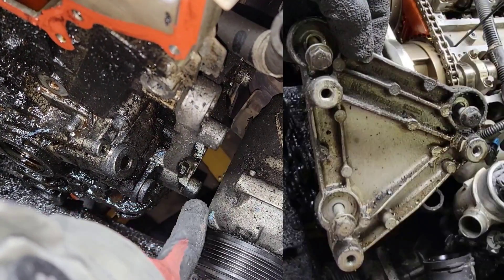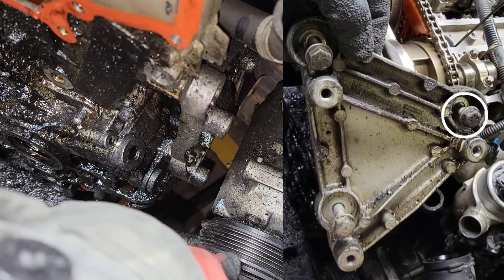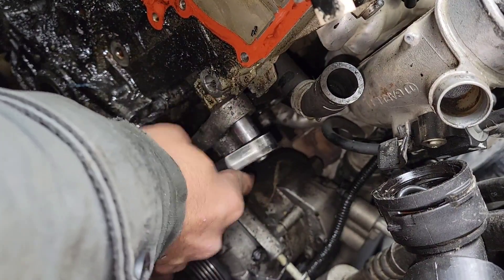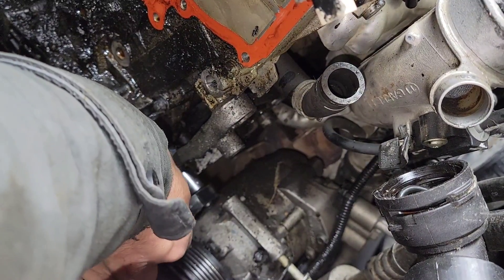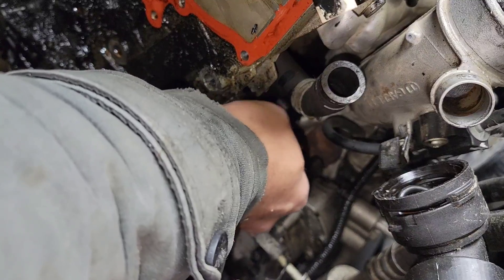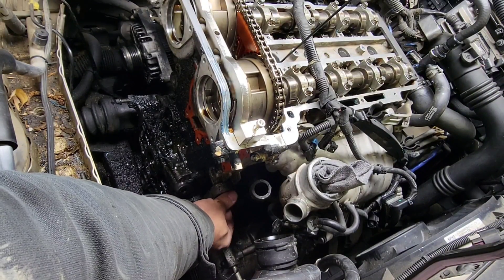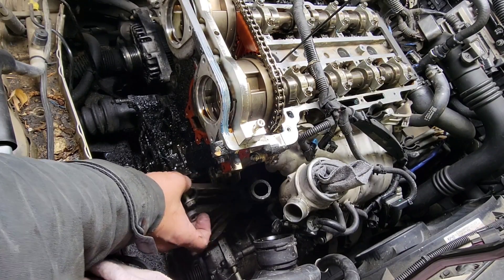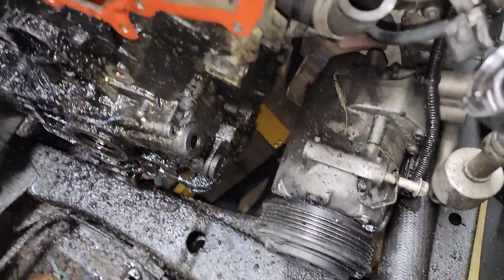All right, the AC drops - it's loose. There you go, AC just hanging on the corner right there. Now this is the bracket - there's three bolts, two on the top on the front right here and then there's one at the back. 13mm on this one - one right there, second one right here, and then the last one way back over there. All three bolts are loose and then there's the bracket - looks like this. There we go.